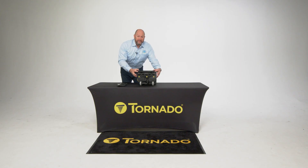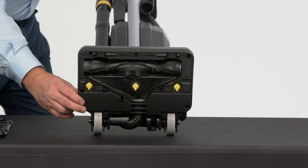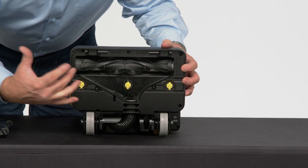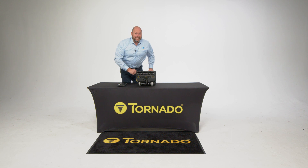What's also very cool about this machine is the fact that it has a self-cleaning mechanism. This yellow button right here — when you turn on that brush roll and hit this yellow button, it's got a picture of scissors on it. What it will do is take that brush roll and pull it back towards the cutter. There's a cutter in the back that's going to cut all the yarn and hair that builds up on that brush roll. Self-cleaning is a huge feature and a time saver — to have a built-in self-cleaning mechanism for that brush roll is unique, different, and very cool.